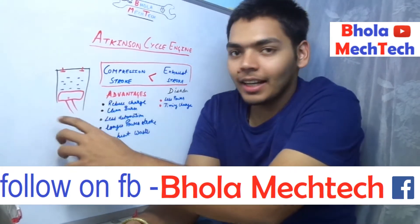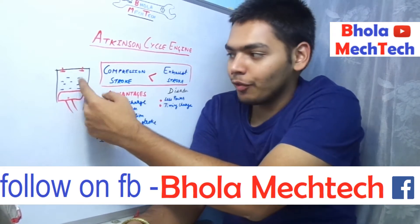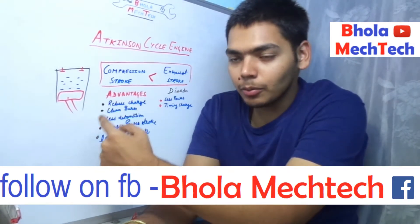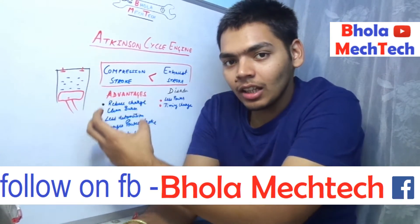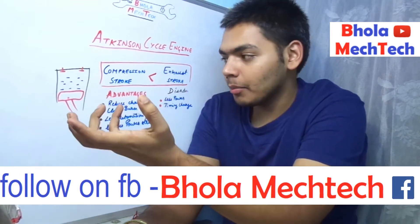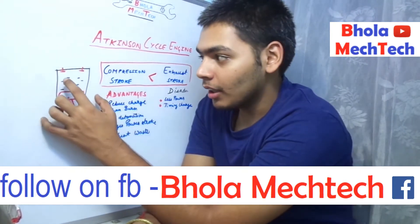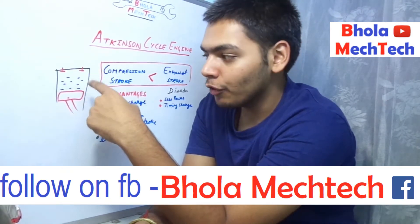This black line is the cylinder, these are the valves, this is the air-fuel mixture, and this is the piston. During the intake stroke, the piston goes down from TDC to BDC — top dead center to bottom dead center — and inhales the full swept volume of air-fuel mixture from the inlet manifold. In the Atkinson cycle, the intake valve is kept open for some time while compressing the air-fuel mixture.